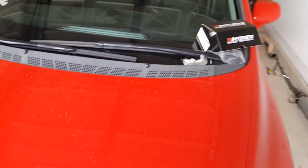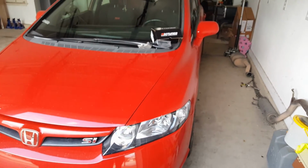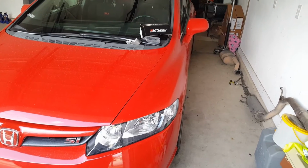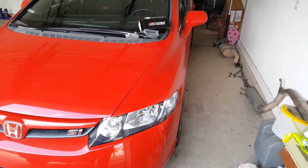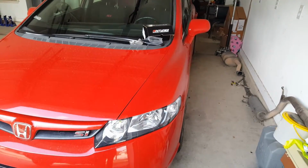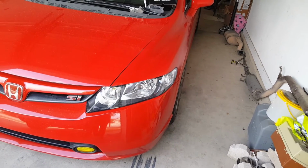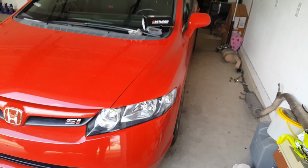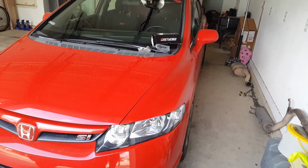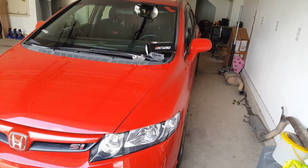But yeah, it feels totally different though. I mean, there's actually a real feeling in the clutch pedal. I can actually feel the staged clutch now as compared to whenever I got it back, because it was making the same noise whenever I dropped it off. So it definitely contributed to my clutch slipping, probably with the old clutch failing, because it wasn't able to fully disengage or engage. Because whenever it snapped, I had no control over my clutch pedal. It was just all or nothing.